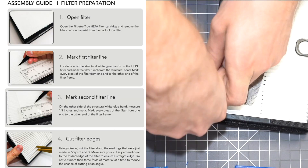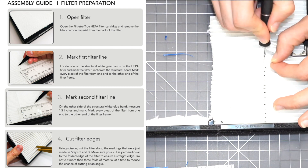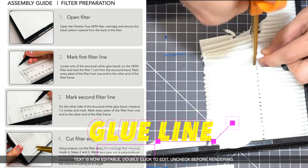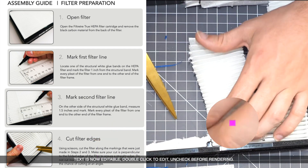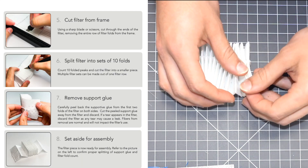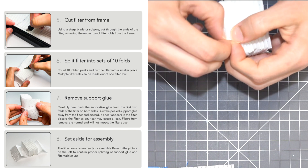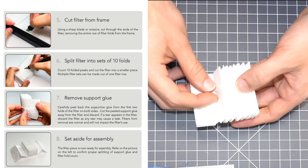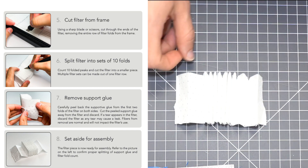The next step is to cut a HEPA filter. You get these filters at Home Depot, Lowe's, or anywhere. Mark a line one inch away from a bead line — you'll see little bead lines on these filters, which are little hot glue lines. Measure one inch away from that and cut a piece that's too tall and too wide, which is okay. Then roughly count ten folds, and remove the glue from two folds on each side. Just pop off that little glue bead — it peels right off, kind of like hot glue holding the pleats together.